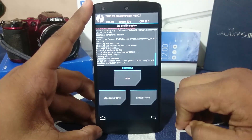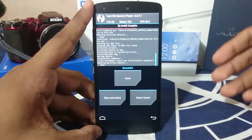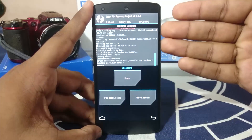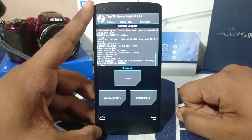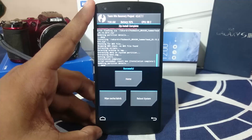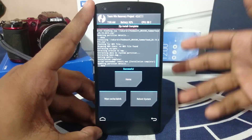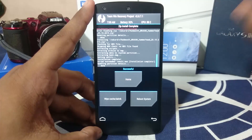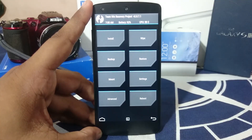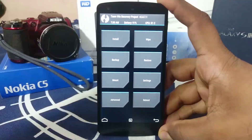As you can see, the flashing was successful this time because I unmounted the system partition manually. You can now reboot the device. It will ask if SuperSU is not installed — that's why I like Team Win Recovery Project a lot, because it detects if SuperSU script is not installed and asks if you want the recovery to flash it. I normally select no, but it's nice to know. That's how you flash a ROM in TWRP.